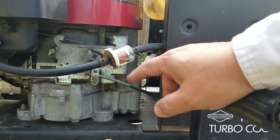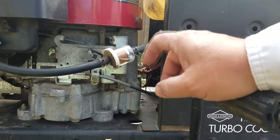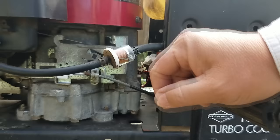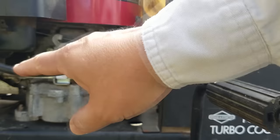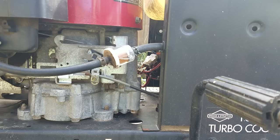This mower actually developed this problem last week, but it's been raining here in the northwest so I just haven't had a chance to mow. There's a little bit of fuel in here, but that's not enough to get from here into the carburetor. Last week this filter was bone dry. This has happened to me before on lawnmowers in previous years — it's just this fuel line goes to crap with the ethanol fuel we're running nowadays.